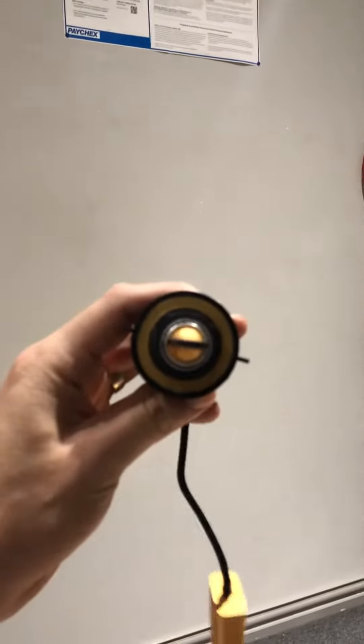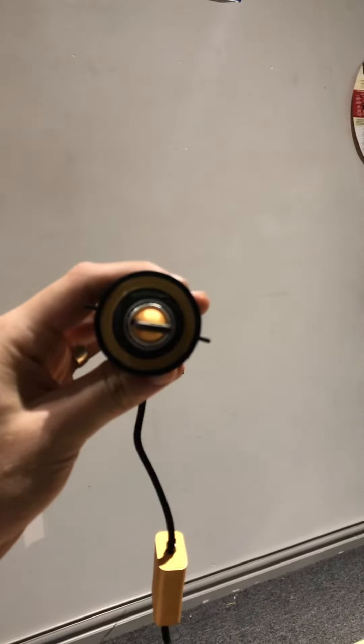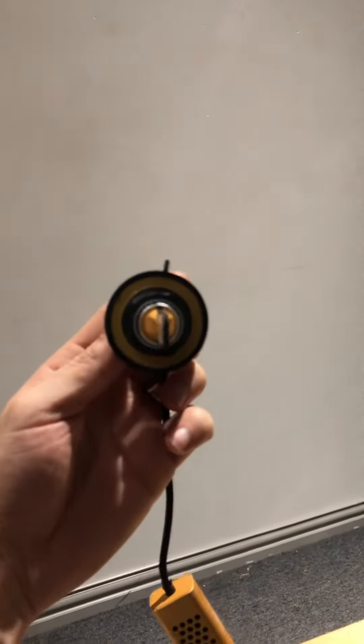If you're looking at your headlight and you put your LED bulb in, and you look at the front of your headlight and it's crooked, that's not correct — the focus will most likely be wrong. You want to have it at 12 o'clock and 6 o'clock, just like this. Right now we're going to turn on the LEDs and show them in an unfocused mode.